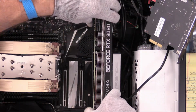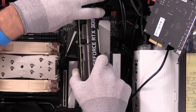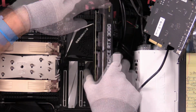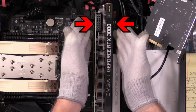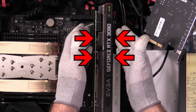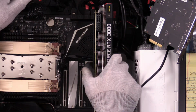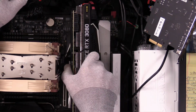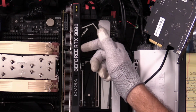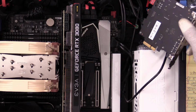Thunderbolt is out. No go. So priorities. If you put an RTX 3080 in here, you don't lose, just wow. The RTX 3080 is wider, and I didn't realize the thickness as I was looking and comparing the 3080 to the 2080. But wow, that's significant. So what we have to do is prioritize what we want to do. If we want the RTX 3080 in here to do rendering with the CUDA core count we've got, then we will not have Thunderbolt 3.